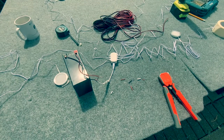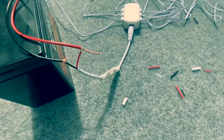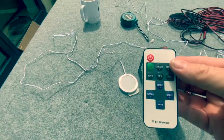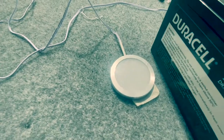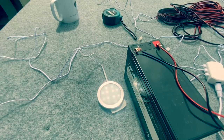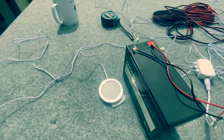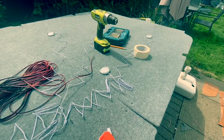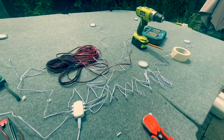The bench test is now all wired up, connected directly to the battery with the wireless module clipped in and the wires bundled together. Here is the remote — moment of truth. They are flashing, but that's because these have a flashing mode as well. Really happy with that — bench test worked, no issues at all. Now we're going to position the LEDs on the headliner, pop the wires through, and route them all back to one single point ready for the first fix of the wiring into the van.